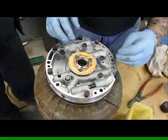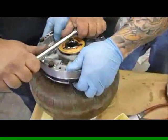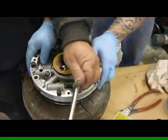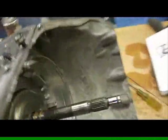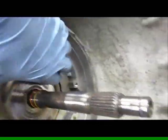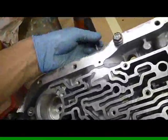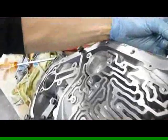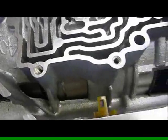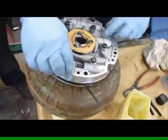Now we're tightening up the pump halves. In lieu of the proper tools, we're using tie wraps to align the pump halves sitting on top of the torque converter itself. If you're off by even a few thousandths of an inch, you can really mess up your torque converter bushing, so you want to make sure everything is right on line. The front parts are back in — overdrive clutch sitting behind the oil slinger — and we're basically at the point of putting a shift kit into the transmission. The wide band is now installed.